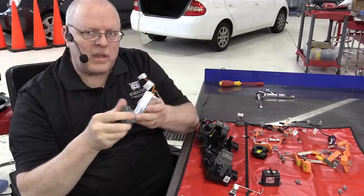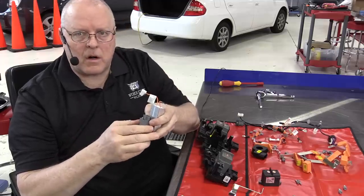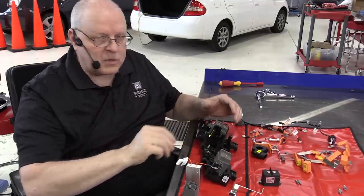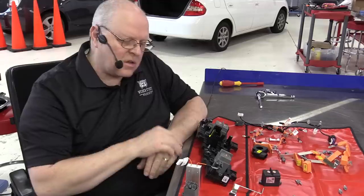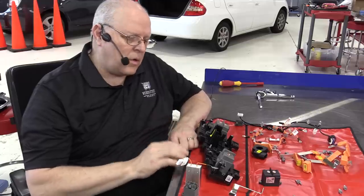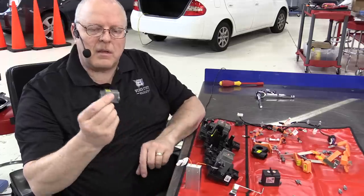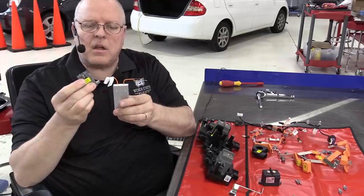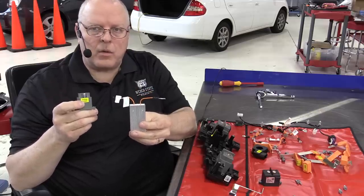But this is only used during the initial power up of the Bolt EV, when you hit the power button and turn it on. So before we can close both the positive and negative contactors here and just connect the battery to those cables, we have to do it in a specific manner so that we don't create arcing or any damage inside of these contactors or inside of the inverter assembly underneath the hood. So instead, what we do is we close the positive contactor first, and instead of closing the negative contactor next, we close the pre-charge contactor, which basically does the same thing as the negative contactor, but it does it through this resistor. So it will create a low current path for current to go into the inverter assembly, where there